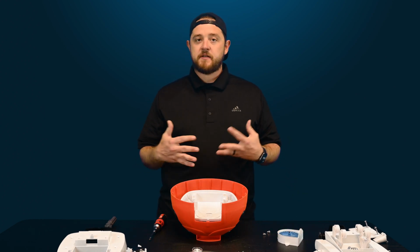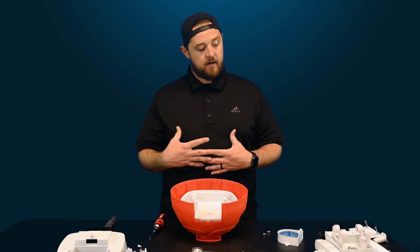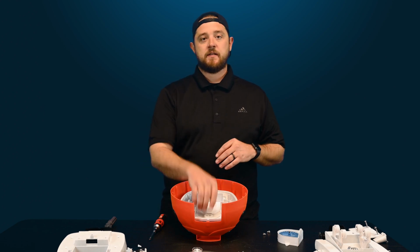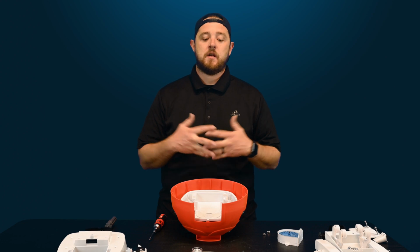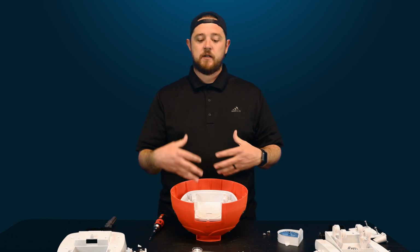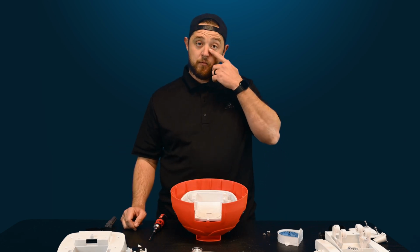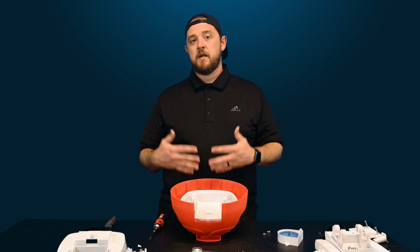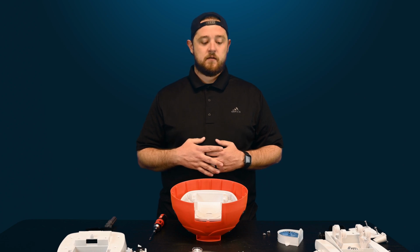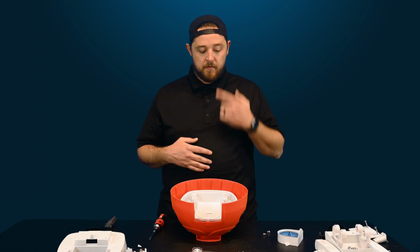Even though this cleaner is pretty basic, it does have a really good intricate gear system making sure everything works. So if you have a lot of dirt and debris in your pool, there's a lot of smaller gears for that to get stuck in, especially sand or any other kind of grit. If it's not working on you and you take it apart like this, always make sure something as small as a grain of sand in between these gears could get it to stop working. So you do want to treat it properly and clean it efficiently, so that when you use it the next season or later that season, it actually works right for you. So really simple.